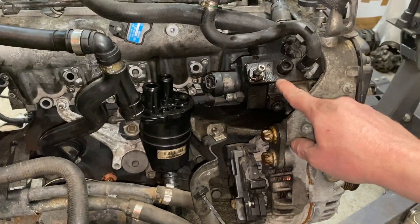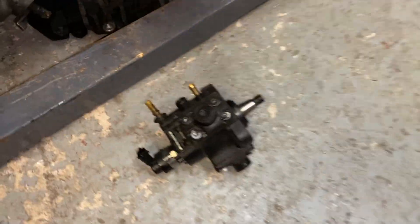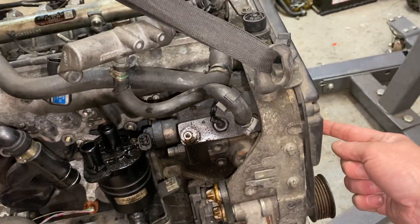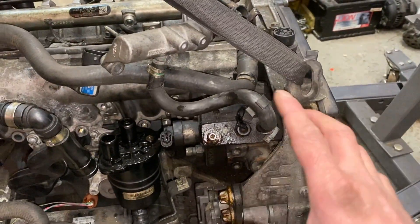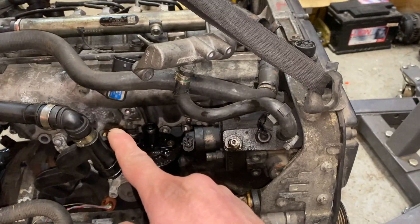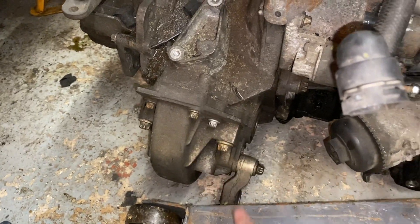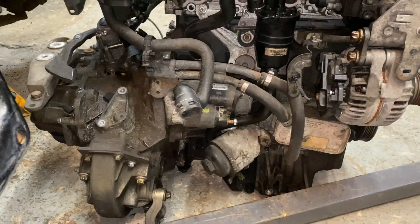This is classed as an R70 pump and this is an R80 pump — you can tell by the sticker. You've got to take the timing cover off, pin the pulley to take this off, spin the bar off, take it off. But whilst that's off you can easily do the inlet manifold, hence me taking the engine out. Plus when we did it I never sealed the back casing, and I've also got the paddle clutch to put in.